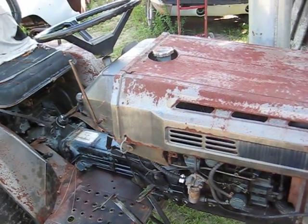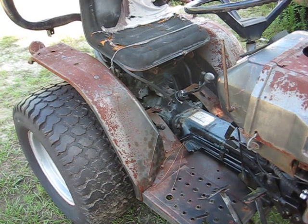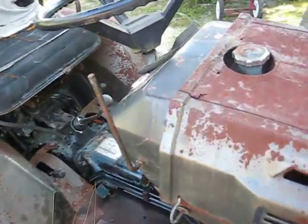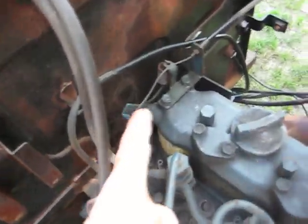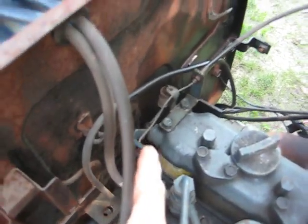So we brought it over and dragged it off the trailer. I checked it out and it had a locked up brake, so I got that freed up — I knew then it wasn't the engine. I kept turning it over and it rolled over real easy, but this cable was stuck, so the compression release was stuck open on the thing. I got that straightened around.